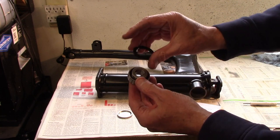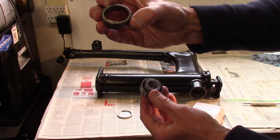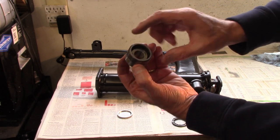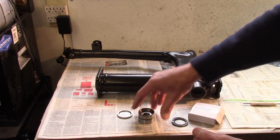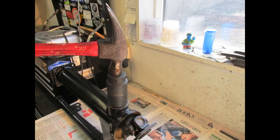To install them, I pull the dust cap off and then I can use an old outer race, put it on top of the outer race of the new bearing to drive it into the hole in the swing arm. I tried using the old outer race with a socket to drive in the new bearing, but found it hard to keep the new bearing square in the hole. For the second bearing, I just used the socket and it went a lot easier.